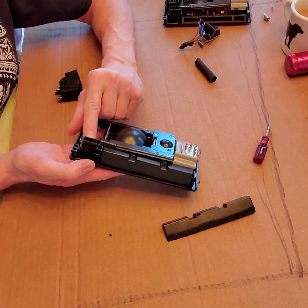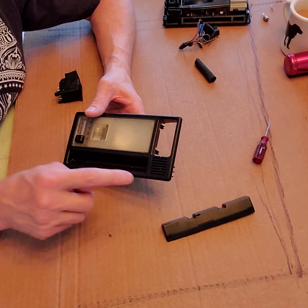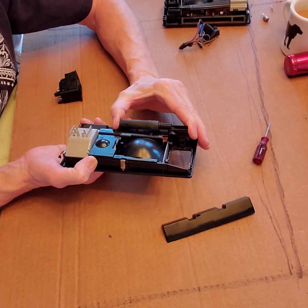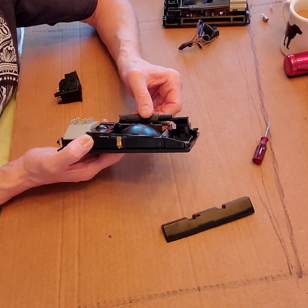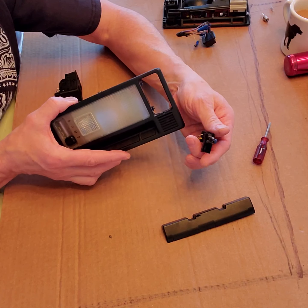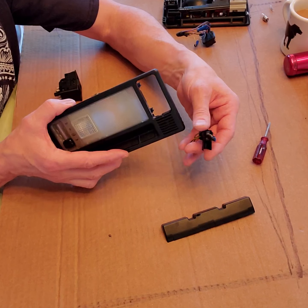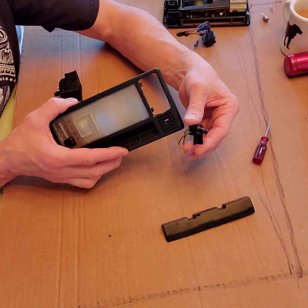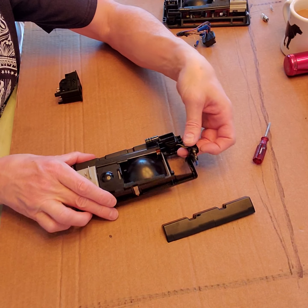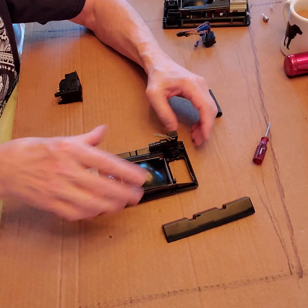The hardest part was this sensor opening right here. There is a tiny vacuum pump, a tiny little air pump underneath the dash somewhere that connects to a hose. I cut the hose when I pulled this guy out — one of them had a hose, one didn't. This hose goes underneath the dash and the little pump pulls air through here and across this sensor. When you set the automatic temperature control, that sensor tells the car what temperature it is, and the computer adjusts the temperature accordingly because Mercedes won't allow you to manually control the HVAC unit — the computer does it based on input from this sensor.